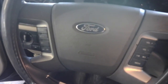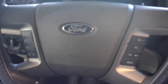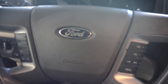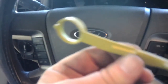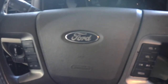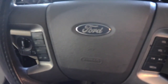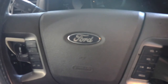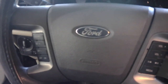That about does it for a Ford Fusion clock spring — it's not a real complicated job. You will need a steering wheel puller, and be careful with the tab on the new clock spring. I've actually gotten one from the auto parts store where that retainer tab was missing — check it before you leave the store. If that pin is not in there, the clock spring is probably no good. Thanks for watching, and as always, God bless.